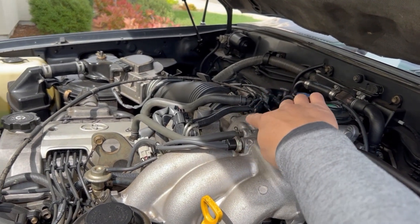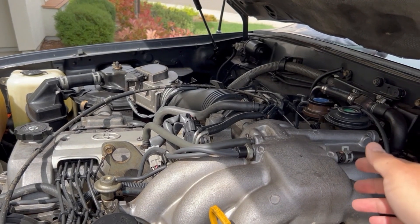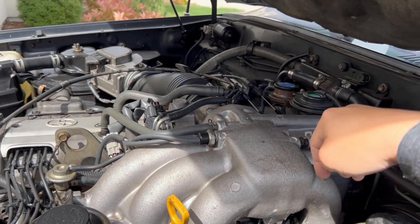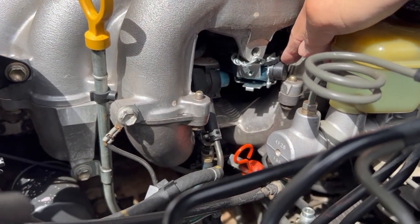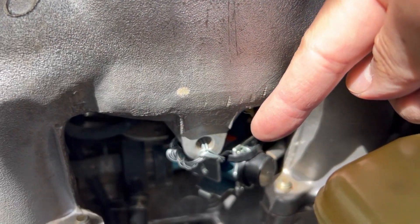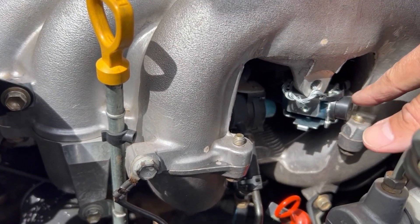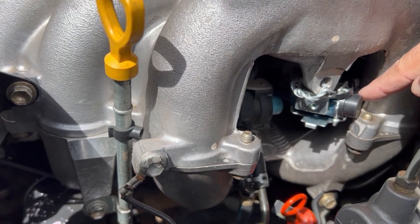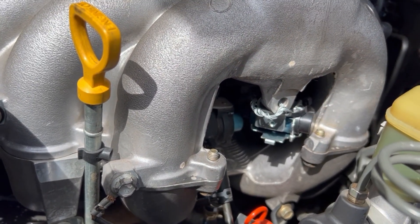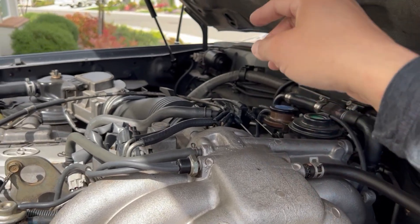As you know from the service manual, you have to remove the whole intake manifold, which requires a lot of work and is quite difficult. What I did instead was take out the throttle body — there are four bolts from the video I shared — clean it out, and then you have access to this side of the intake to remove the hoses and the plug. I put the vacuum switching valve here and extended the hoses to reach out this far.